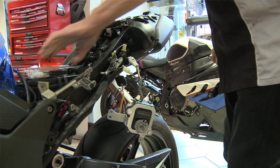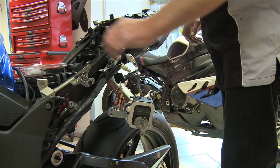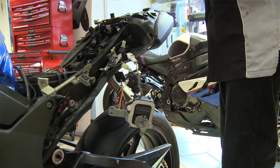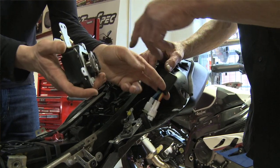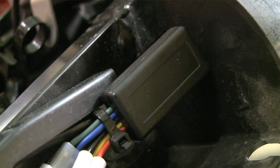In addition, the servo motor was removed. The servo motor weighed a fair amount when we initially weighed it, and it was replaced with what is called a servo body. The reason for that is a fault light would appear on the dashboard, which would send a signal to the ECU and potentially put the bike into a default mode. By fitting the servo body, the weight has been removed, the cables have been removed from the machine, and it now works purely as a noise suppression valve.